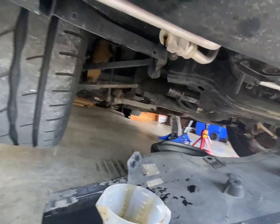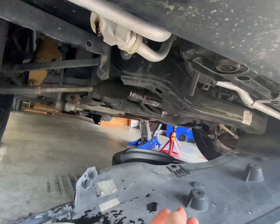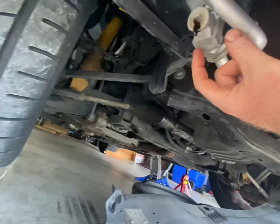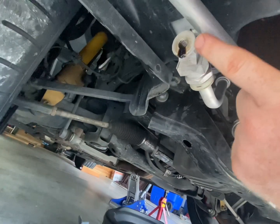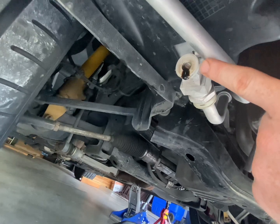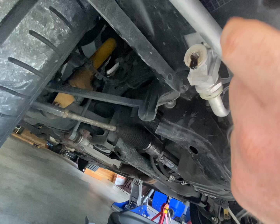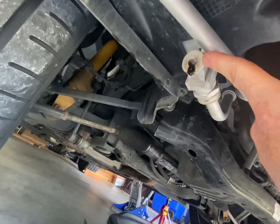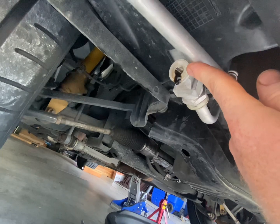By the way, since I'm talking about this — take a crescent wrench and put it right here. You put a crescent wrench around this bit and it helps you ratchet that 15 millimeter nut off. Put the crescent wrench around that part, 15 mil, then ratchet it off. There's very little torque on it — it's very light on there.